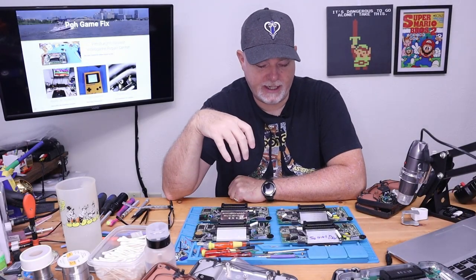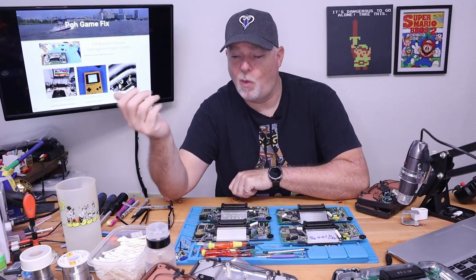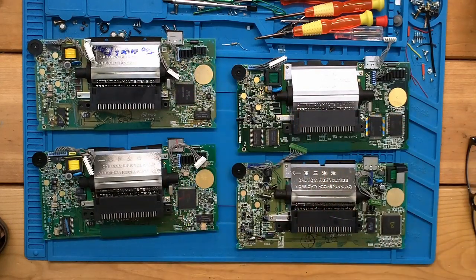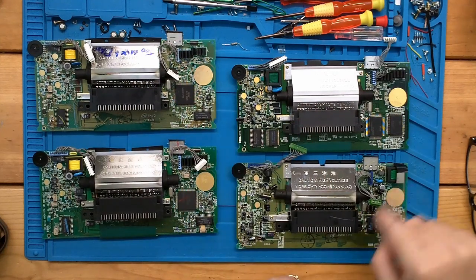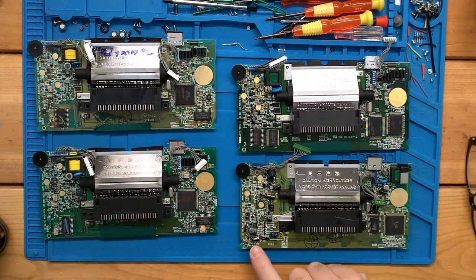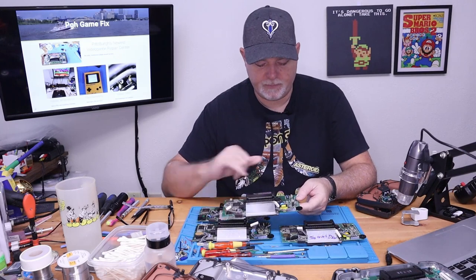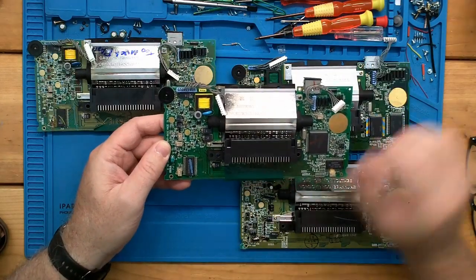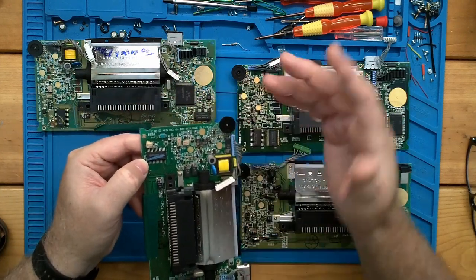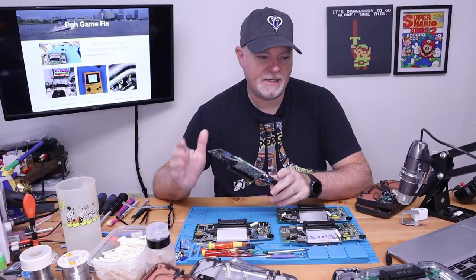I laid out a few of the boards from that junk bin to show you some different versions. There's the ASIC 1 and ASIC 2 type boards. Here are your two ASIC chips or your single ASIC chip - basically your processors. Both of them have the memory, just in different locations. Here's the unconventional electrolytic capacitors that Sega used - they're actually small can capacitors in a plastic shell, laid flat and glued on. Really quite unusual. This was a board that came to me - the K variant. It got recapped, came back to life, had sound and everything was great.